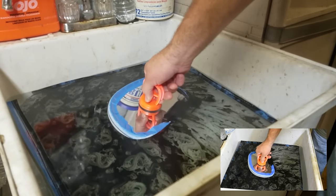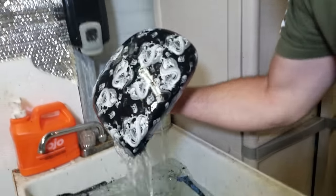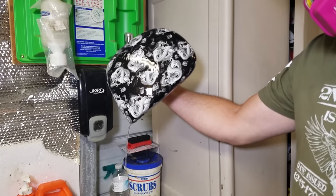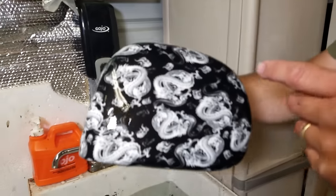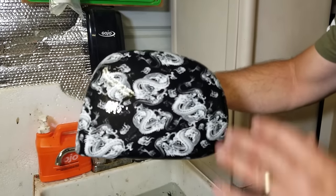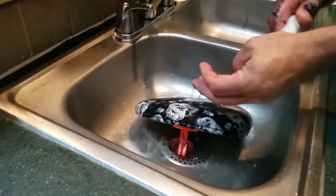We're going to do a nice angled push — bottom end in nice slow and steady, and remember to never bring it back up. Give it a nice mix. We're going to pause and run inside to rinse it off with hot water for about three minutes. You can tell when you're done because right now it's very shiny — that's the film residue you need to rinse off with hot water for about three minutes, then it'll be dull. Don't worry, your clear coat will bring the shine back.